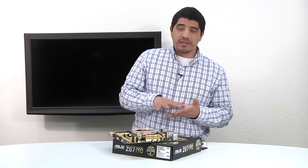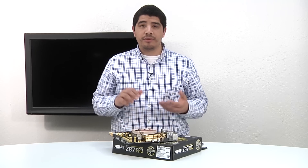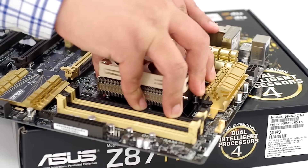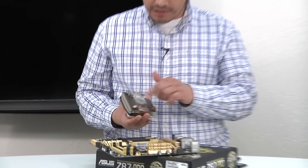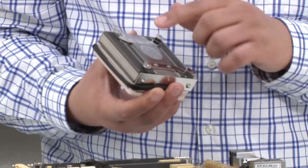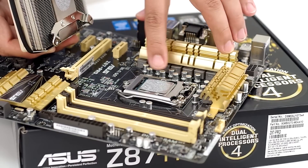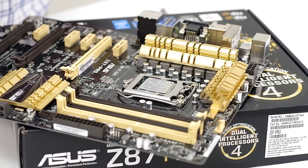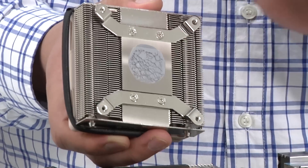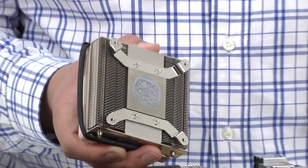At this point the compound has spread out a bit, so you want to be careful when pulling up — don't pull away too aggressively or you'll smear the compound. Pull upward gently and you can see we've got a pretty clean contact, good circular coverage almost in a square-based fashion. From the camera angle you can see we've covered a pretty good amount of the CPU surface. Overall that's how you successfully apply thermal compound.